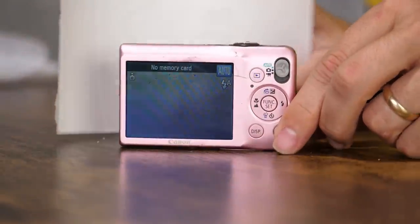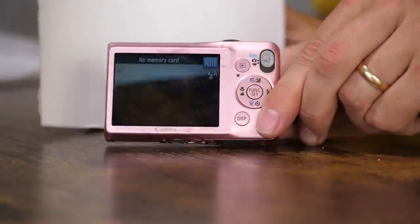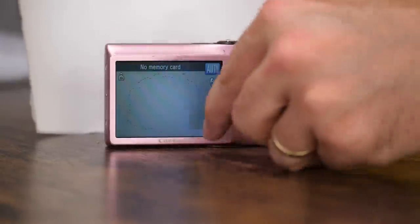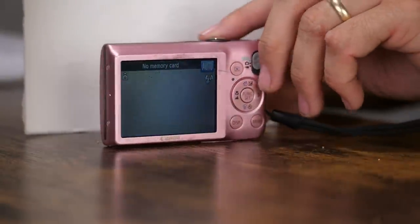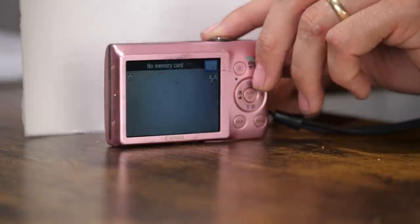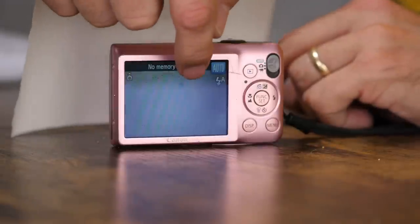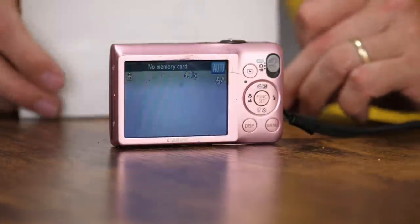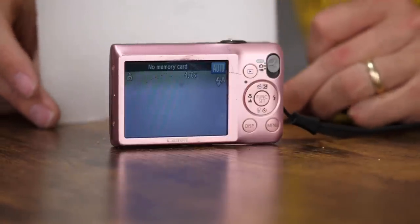We have this nice lemon-shaped line of dead pixels. I think you should be able to see them there, hopefully. Just all the way around there. So normally that doesn't affect the actual picture, but as you zoom out, I don't know if you're able to show this part. There are actually dust spots visible, so probably dust in the sensor. There's a big spot right there. So normally that just manifests itself when the lens is fully zoomed out, kind of magnifies the dust particles.